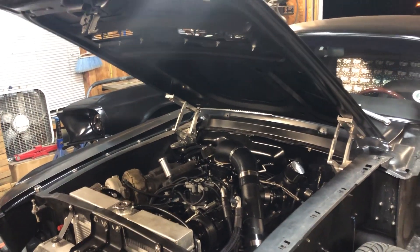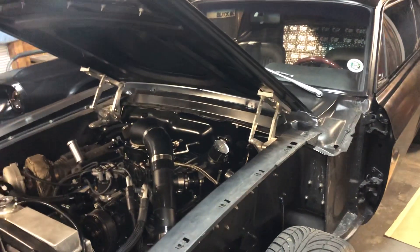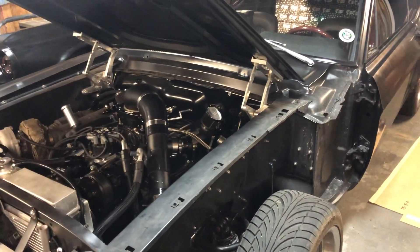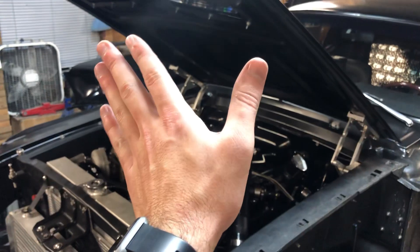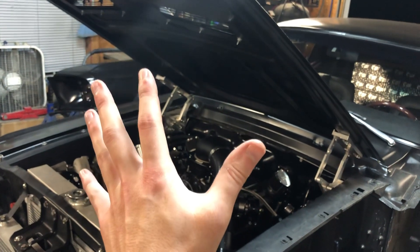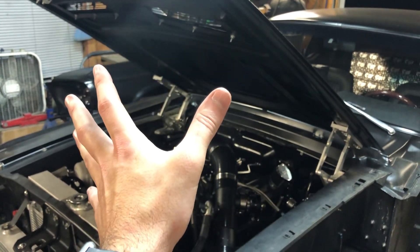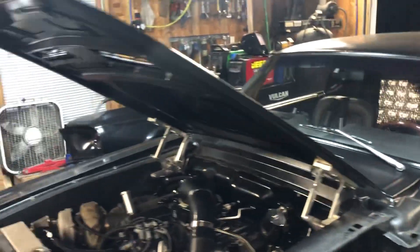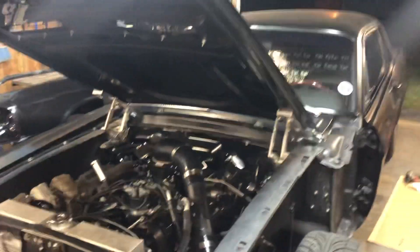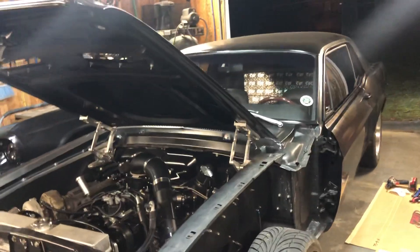There's also the transmission and clutch conversion — I want to put a T56 in. Right now it's got a T5 with a six-puck race clutch that's not enjoyable on the street. The clutch has a lot of force on the pressure plate — it grabs, slips just a sec, grabs again, and the rear end shuttles back and forth. With a little slop in the rear end, it hammers away like an impact wrench, which is surely going to tear up some U-joints. You have to bring the RPMs up to about 1500 and slip the clutch to avoid that.